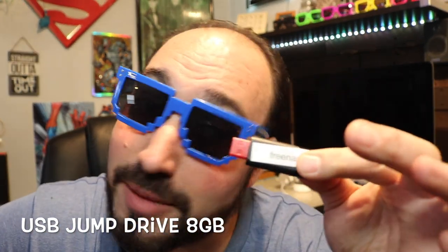Now for my next option - if you have more drives, you can set up a NAS. What is a NAS? It's a network attached server, which is great if you have a lot of stuff and multiple computers and you want to transfer data and just store it. I actually built mine out of an old computer I found in the garbage. This is a Dell Inspiron 660, an older computer from 2013, running an i3 Intel processor with four cores, which is really good for a server. It's got about 8 gigs of RAM and a one terabyte hard drive, running Windows 10. This whole thing also runs FreeNAS on a jump drive - get a little 8 gig jump drive; technically you should get two for redundancy backup.